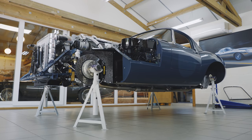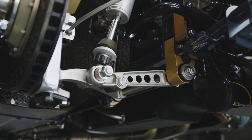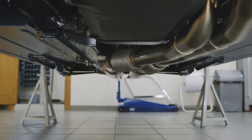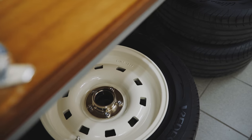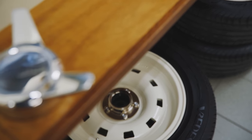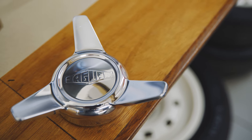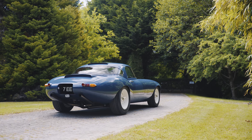In this spec, it has had the proverbial magnesium kitchen sink thrown at it. There are lightweight wishbones, tubular driveshafts, inconel manifolds, a titanium exhaust, and magnesium is used for the gearbox, differential housing, sump, and hubs. The featherweight cherries on the slim-fast cake are the specially developed aluminium spinner nuts on the magnesium wheels. All in, this car has a dry weight of just 1,017 kilos.